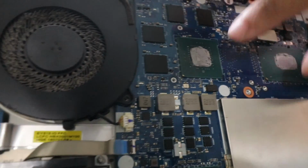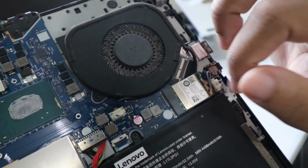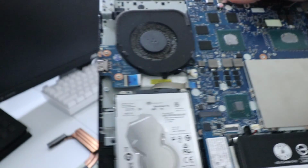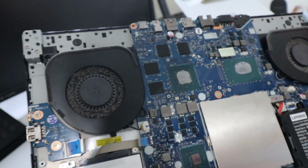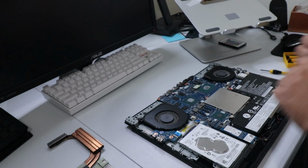And when it comes to taking these fans out, you're going to have to pull them out of the motherboard right there. And then for the other one right here on this particular computer, yours should look similar. Now, keep in mind, you want to be very gentle with that. You don't want to pull too hard and break any of the wiring, or you're going to have to order another one. Not going to be fun.